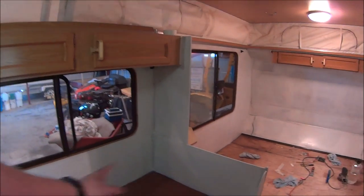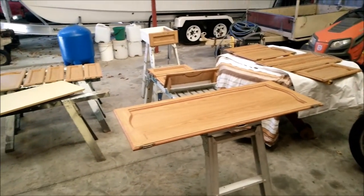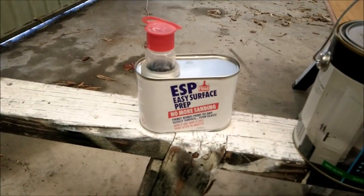Tiff's still working on all the upholstery. I've also had to re-secure the floor down in spots — the old pop rivets have just pulled out, so I've pre-drilled all the holes into the chassis rail underneath and driven some metal head screws in there. They're sitting below the surface so it's not going to be an issue with the vinyl. We changed our mind and decided we'd paint the cabinets as well, and the bench tops rather than replacing them. So I've pulled all the cabinets off and removed all the hardware.